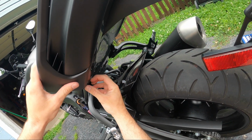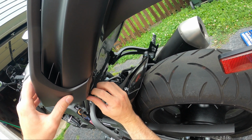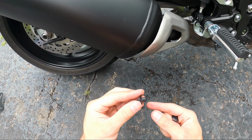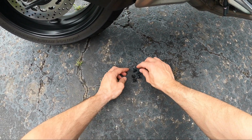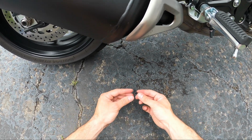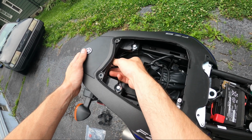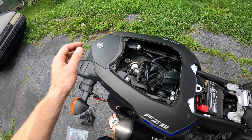All right, once you push all those in, you just have to try to get your finger under there and pull them out. Once you get all of these out, it's important that you push them back up like this, so that when you go to reinstall it, you can actually snap them back in. So each of these push pins, you want to make the pin stick back out of the top on each of these. There we go. You've got to remove the brake light.